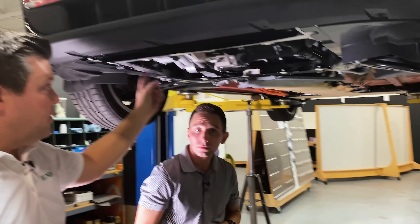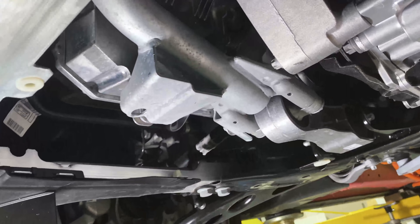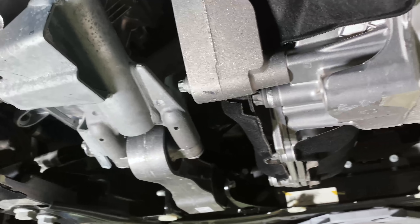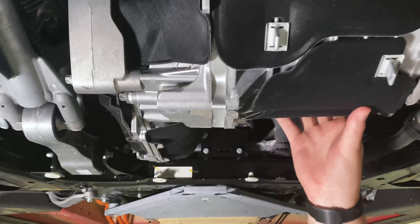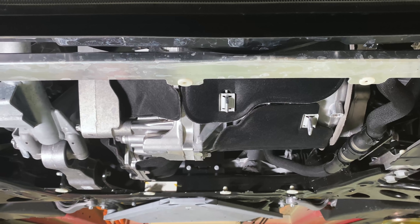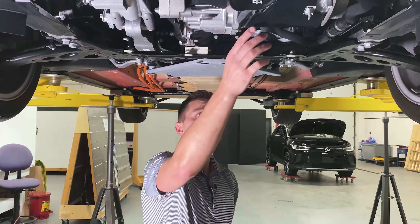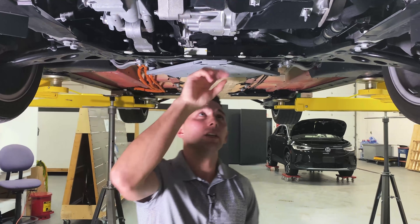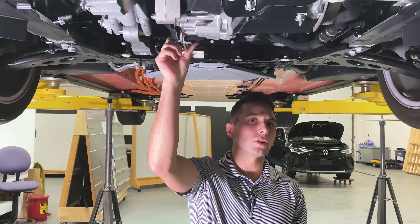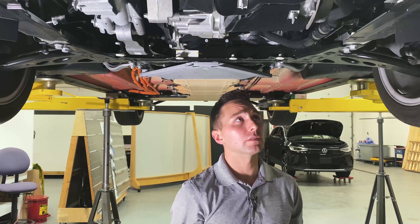As far as EV component packaging, you can see that large steel weldment we showed in the engine bay — incredibly complex, but it wraps around all of the EV components. We did notice a little bit of NVH padding around the electric motor, probably to protect for certain frequencies — gear whine, EV whine. This is the thinner, lighter version — sometimes referred to as motor diapers — but NVH pads nonetheless. In some cases you'll see a thicker EVA foam; this is a thinner PET compression-molded version, but still gets the job done.